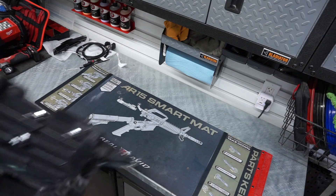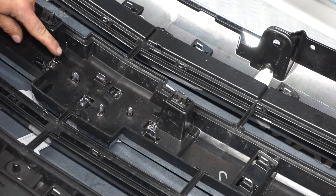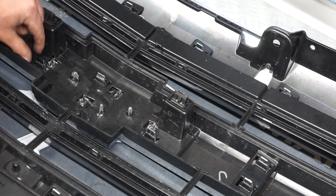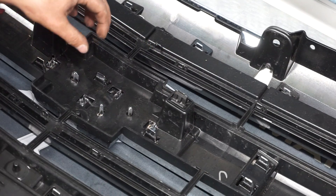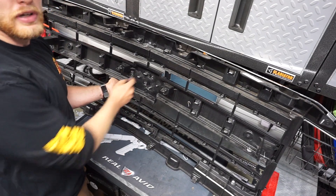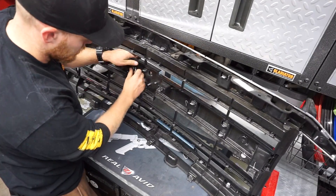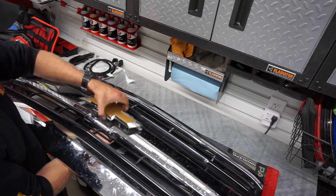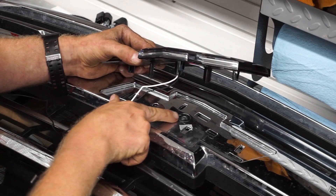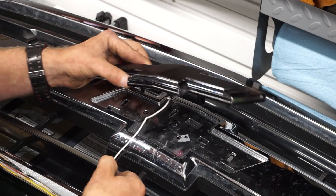There you have it. Now you're going to press against the four silver tabs on the grill — don't do the ones with the black clips, as those hold your front chrome bezel on. Just do the four chrome clips and the badge will pop right out. I'll stand it up so I can push the badge out. Now eyeball where the wires go — there's a little dimple in the grill already, so drill that hole out so the wires can feed through, then clip the new badge in.